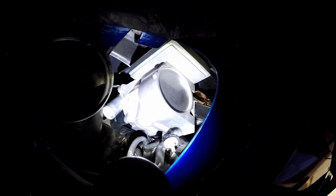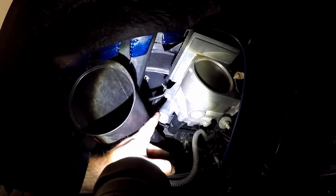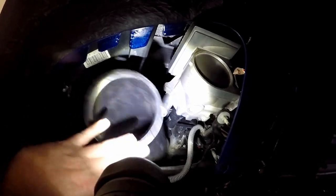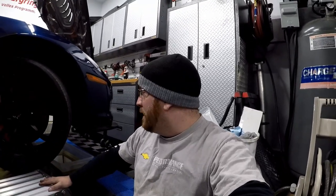This pump is mounted, hopefully for the last time. Now what we need to figure out is the outlet — we're going to have to figure out how to get it pointed back that way. We also have to contend with the brake duct right here, so that's all sitting in the same spot. I'm basing this off of one bracket photo I found — I don't see any other way anyone would install this pump in this space. The pump is sitting at the top of the diagonal brace, pushed all the way against the weld. I had to trim the bracket a little. That's as high as the pump's going to go; the further down you go, the more of that brake duct you'll hit.